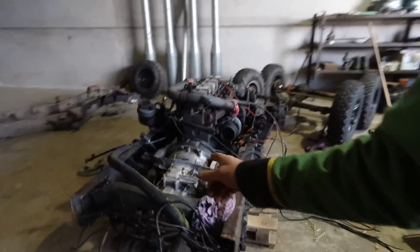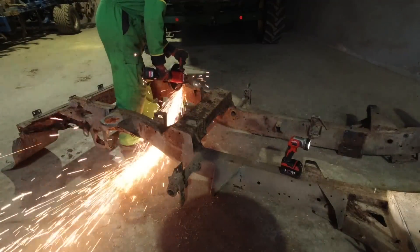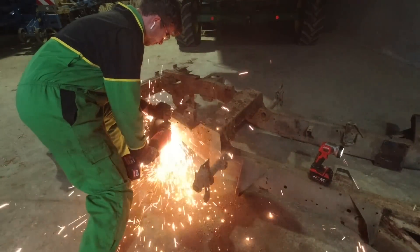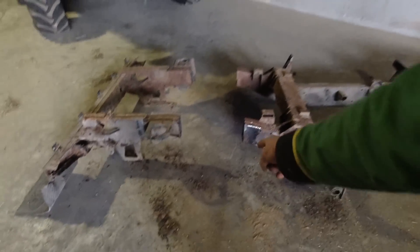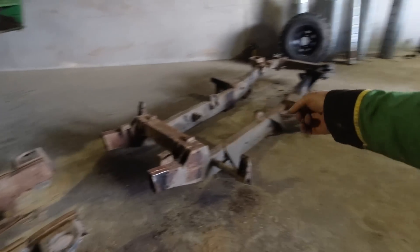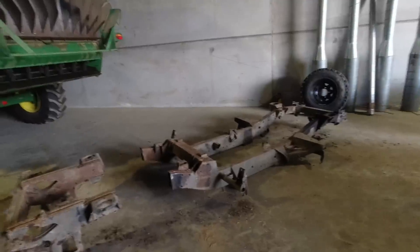Update on what's going on - I did just have the engine going a minute ago, I'll show you that in a second. I've chopped the rear section off the chassis because that's all totally rusted out. I've got a new one on the way and then it's just a case of welding it on. The chassis is going away to be shot blasted, and then I'm going to weld in the engine mounts and transmission mounts, and then it will be ready for galvanising.